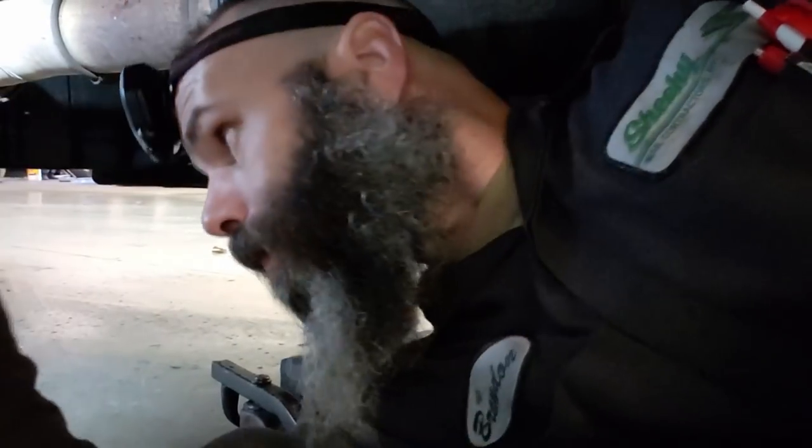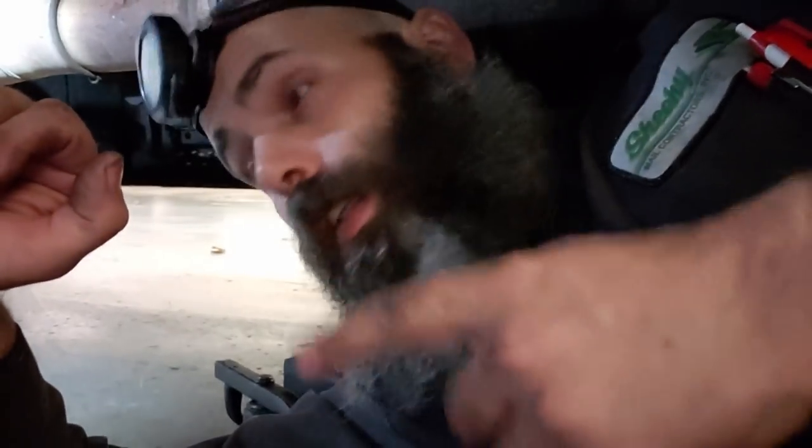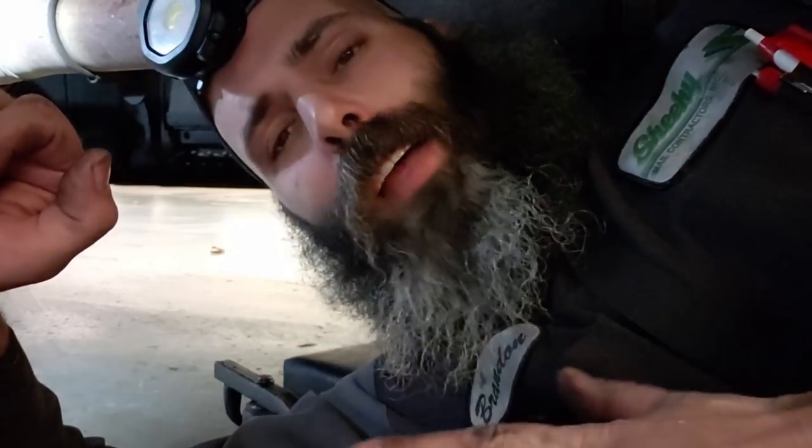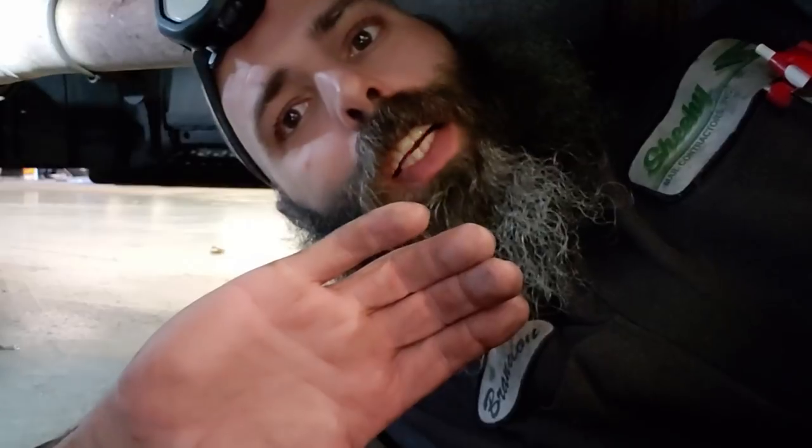All right, so that saved me an unlordy amount of time. We'll go like this. And yeah, within 5 pumps, I already had resistance. Within 20 pumps, I already had almost full resistance on the hydraulic clutch for this thing.